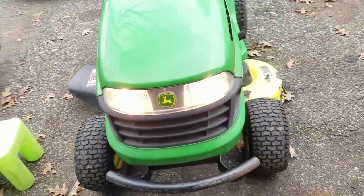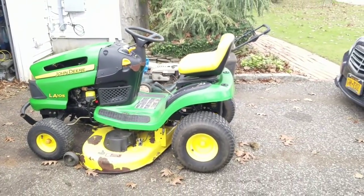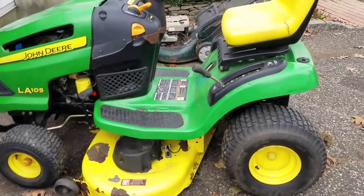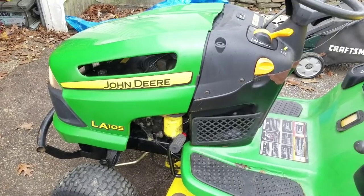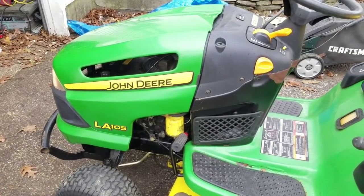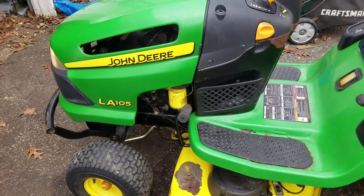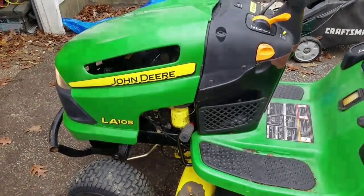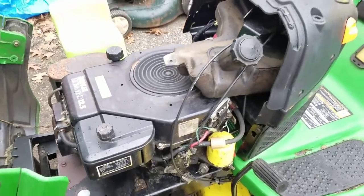Anyway, I've got a gravity fed gas tank now in my John Deere LA105 and it runs great — runs super duper. I'm glad I got that figured out. It's a little rudimentary, not stock, but I could not find a way to get gas flowing efficiently from the back to the front. The stock fuel pumps didn't work right, the electric ones shot too much fuel and it ran too rich, flooding the engine every time. Once you start restricting flow on the electric ones, the motor burns out, gets really hot, stops pulsing — and with gas, that's dangerous. So I chucked it out. Gravity fed fuel tank — runs stupendous.